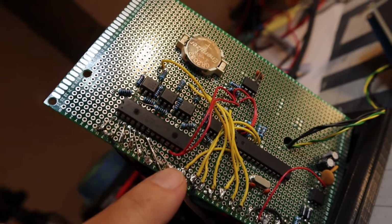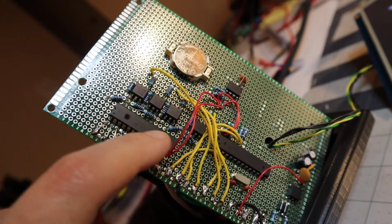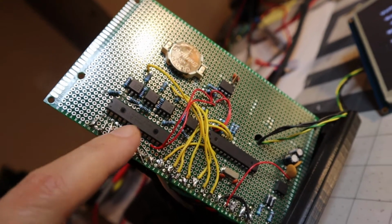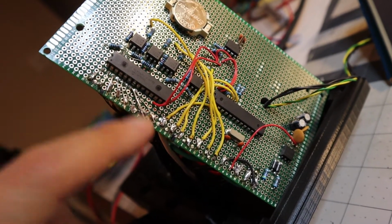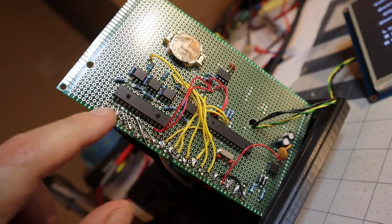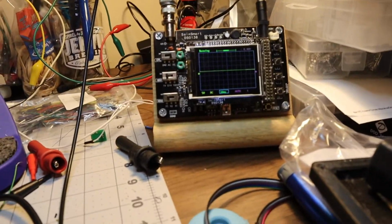Anyway, so what's going on, the same thing with the shock signal. Basically this whole zero bank on this multiplexer is pulled up internally to 5 volts, so they get shorted out to ground. That's how the signal gets detected. But there is no pull up to 5 volts. If we look at, let's see, I'm going to poke it.